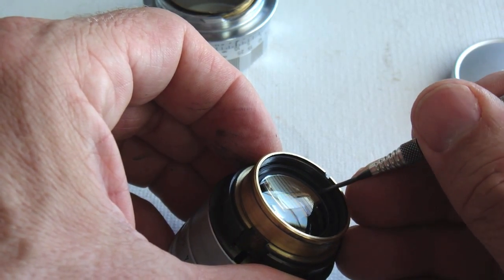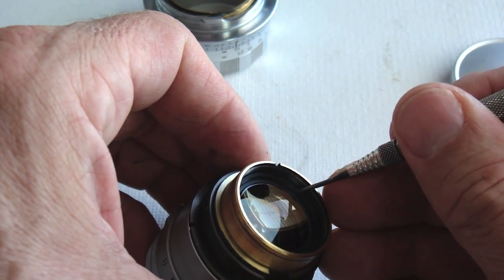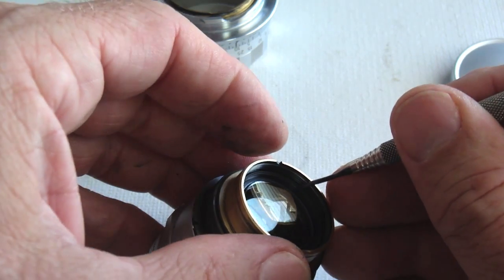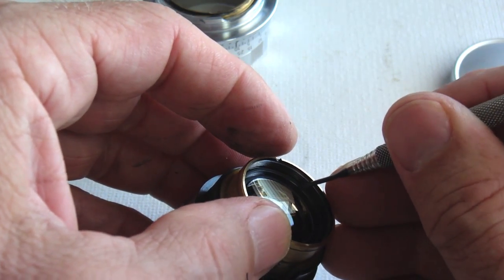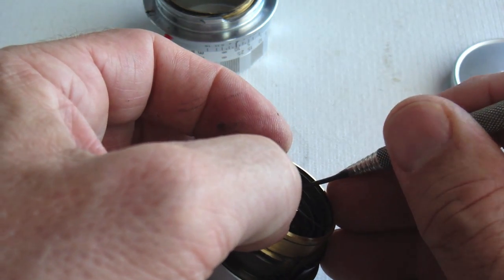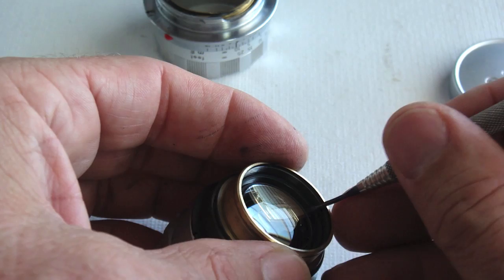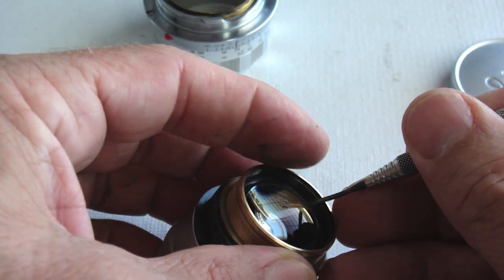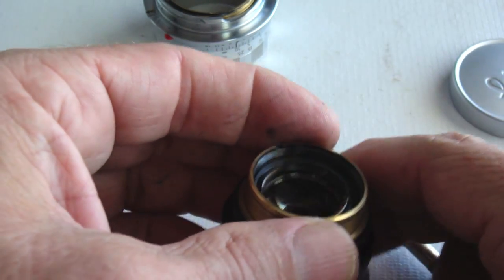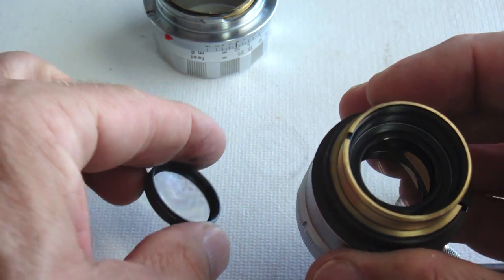There is a spacer ring washer that also needs to be removed. You can use a slotted screwdriver if you're very careful, because you obviously don't want to scratch the lens. For those not so sure of hand, a plastic pry stick or a wooden probe whittled to a flat side can be used to also lift the spacer and in turn the lens without fear of an inadvertent scratch.